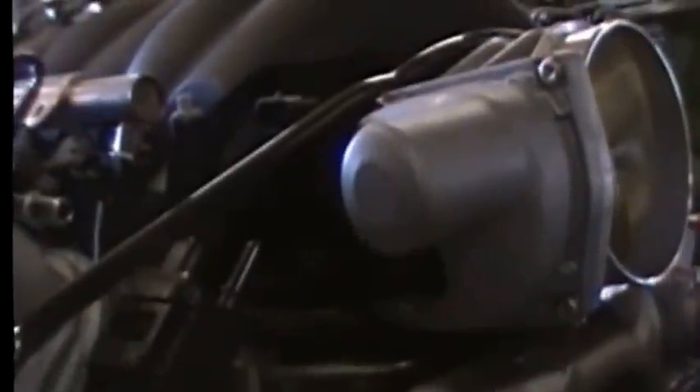This is the purge valve. We're going to relocate this to the driver fuel rail, just like the truck. On this LS3, this line right here is the vacuum line from the intake, so we're going to take this valve off and mount it on either this tab or this tab with the original bracket. Our purge line is going to come up right into it, and this vacuum line is going to go right into the source side of the purge valve.